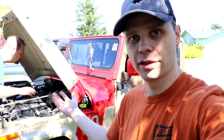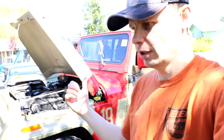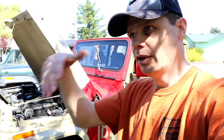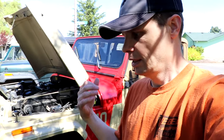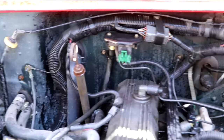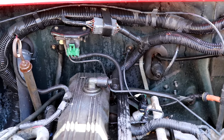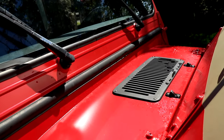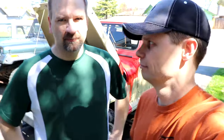He had removed that seal along there when he painted his Jeep. He does have that seal — he needs to still put it back in. Didn't really think it was related to that, but lo and behold, there it was. Weird. We took a seal out and it leaks. It's the seal to the engine compartment from the hood getting into the cab. I guess it's running down the firewall on the inside and leaking. That'll be the first step. It's supposed to rain this weekend, so we'll put that seal back on. We're still not totally convinced it's not the cowl vent or one of these other seals or gaskets up here. So he's going to throw that seal back in and we'll let you guys know. Thanks for watching. Have a good day.